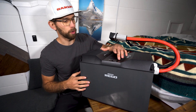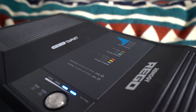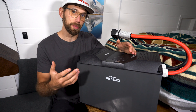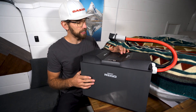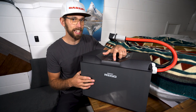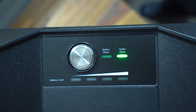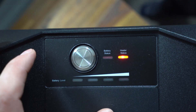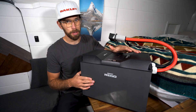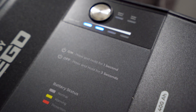The battery has a control panel with an on/off switch where you can turn the battery on or off — putting it into shelf mode or active mode, like some of Renogy's other batteries. It shows the battery status. You can also turn the heater on and off by holding the button for eight seconds; it'll go into a mode where the heater status illuminates and you can switch it from red to green. I'd recommend just keeping that on all the time. The BMS will also protect the cells for low and high temperature.